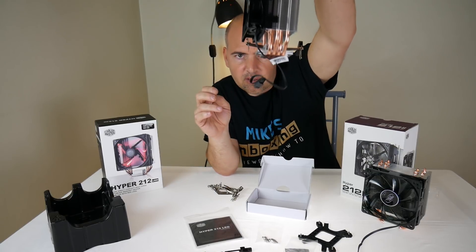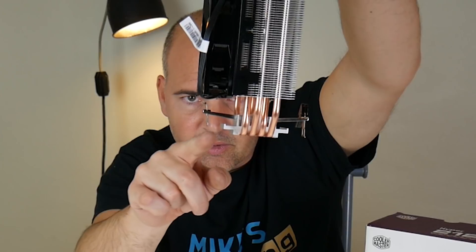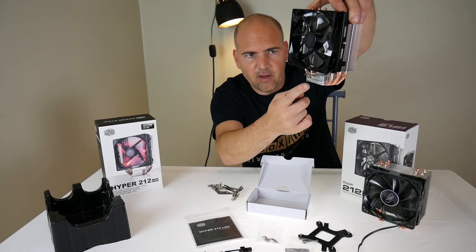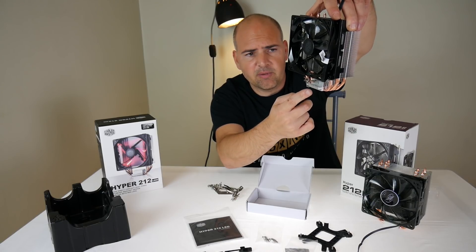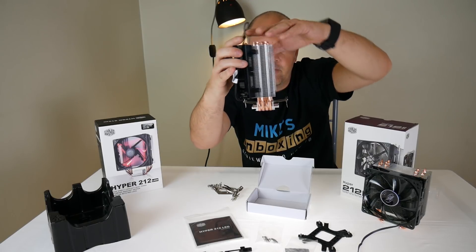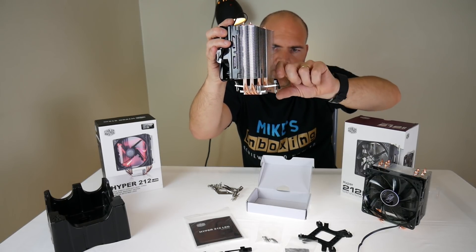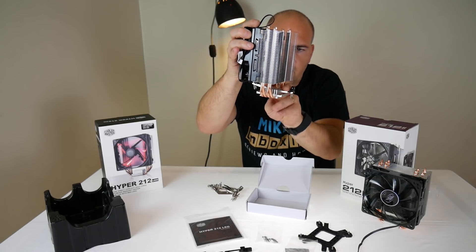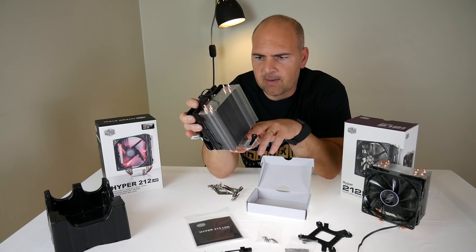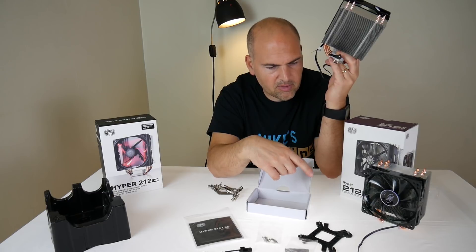That's pretty centralized on both sides — there's about the same sort of gap each side. You clamp down the front bit over the AMD CPU retention piece of plastic — the lug — and then, using the back like the old traditional fans, you just have it loose and then tighten it up, and that will be what holds the cooler to your motherboard. Not as sturdy as some of the backplates we've been used to seeing.